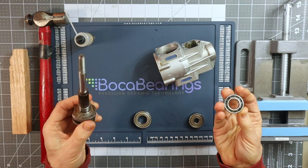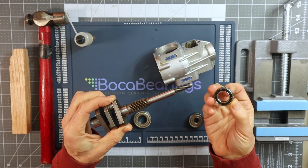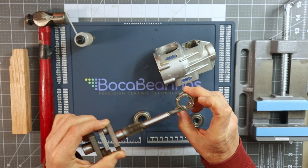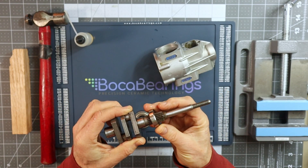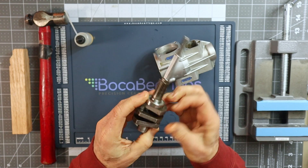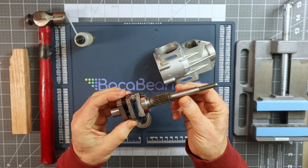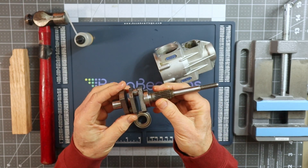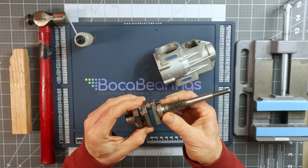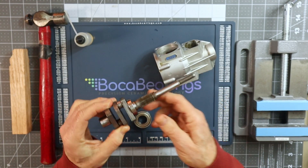What I'm going to do here is go ahead and just slide this mid bearing onto the crankshaft, with the plastic retainer facing the back and the shield facing the front. And you'll see how simple that installation is. So that bearing is installed on the crankshaft, and that's always how I like to install the inner bearing — I always like to put the bearing on the crankshaft itself and insert it that way.